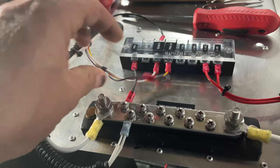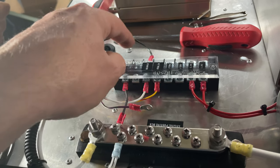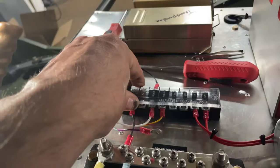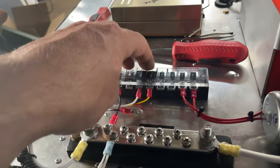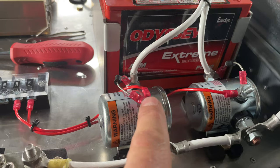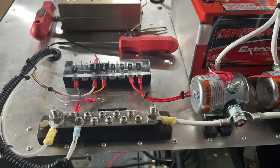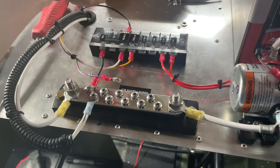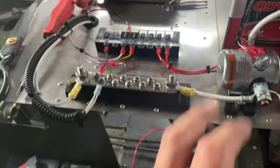I have my ECU starter line going to the starter — I know this is black, it should be yellow, but I had to extend that a little bit to get here. I'm debating whether I just want to drill a hole, put a grommet here, and connect straight from the yellow rather than using a butt connector down underneath. I might end up doing that because I'm not sure I trust that butt connector since that's my starter. Then we have alternator field going in here — going down to the 5-amp breaker, fuel pump one, fuel pump two, battery one, battery two, which are connected to the solenoids that turn the contactors on and off. I'm thinking about putting another grommet port right here so I can run those wires and the starter one right up through there.